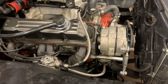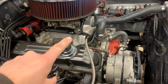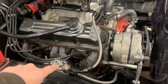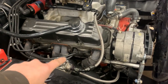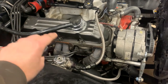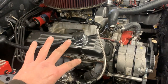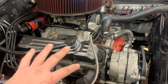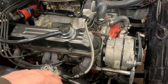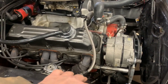One of the things I'm going to do is remove my fuel pressure regulator. According to the nitrous sheet, it needs 8 psi to the carburetor, and my mechanical fuel pump is an 8 psi max, so I don't really need the regulator — I normally run 7 psi anyway. Several people run at 6 psi for a normal carburetor, but being that we'll be running nitrous, we'll set it for 8 psi, which is what the pump is basically rated for. It's a high-volume Carter mechanical fuel pump, so it should keep up the volume without a problem.